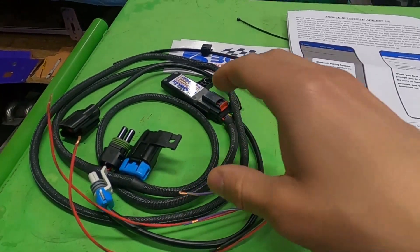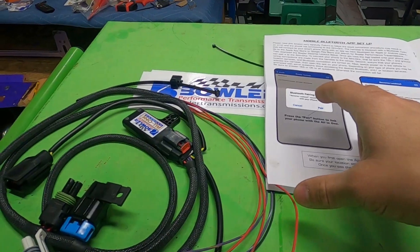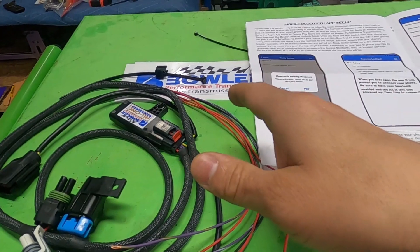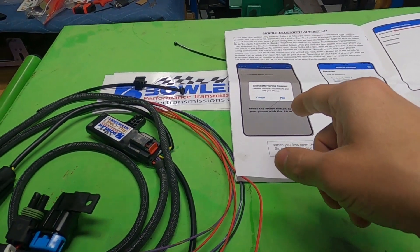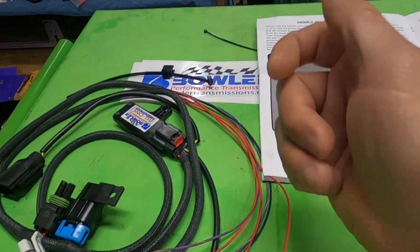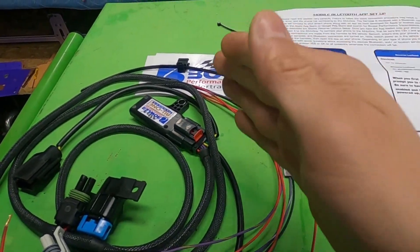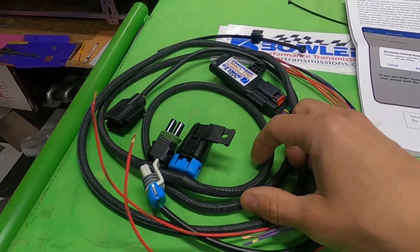You want to make sure you've got that hooked up — another reason to buy this thing. Then you want to pair it and calibrate it. We'll get a reading on the actual car to see what the Holley system says, then open up the app and make sure it corresponds. If the GPS says we're going 20 mph but this says 30, we'll adjust it in the Bluetooth app to bring it down to match.